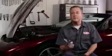Then, start the vehicle, and while it's running, check under the vehicle for any leaks, and check the dipstick once again. Add more oil if needed, but remember to never overfill. Now when you're done, lower your car off the ramp so it's back on a level surface, and check your oil level once again. Thanks again for your question.